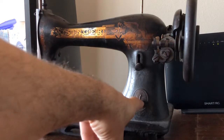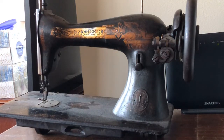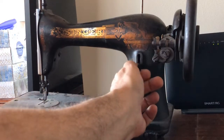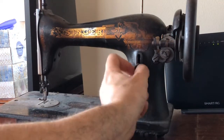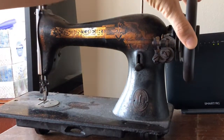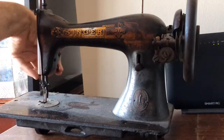This machine does not have back-tacking. Remember, machines originally would have been set up in a treadle table and did not have back-tacking. You could adjust the stitch length — that's what this little screw here is; you loosen it and move it. I'm not forcing it because right now it's not moving, and that doesn't mean it's broken — it just needs to be gone over. When I first get a machine, I'm always very cautious about just trying to run it. I look at the machine, start touching it, seeing what will move and what will not, and very carefully begin diagnosing the machine.